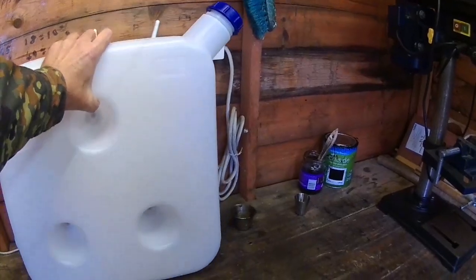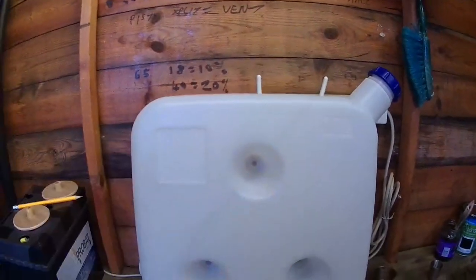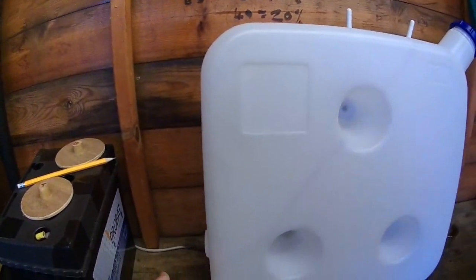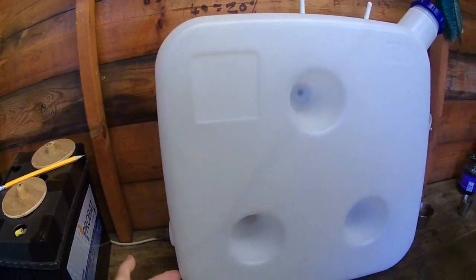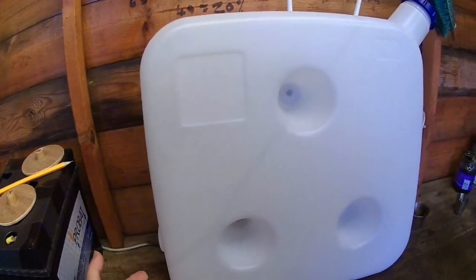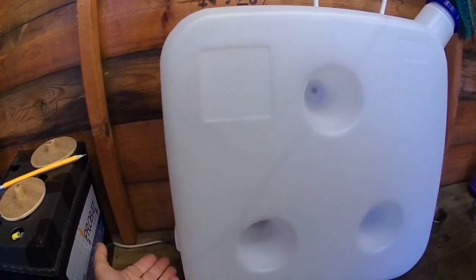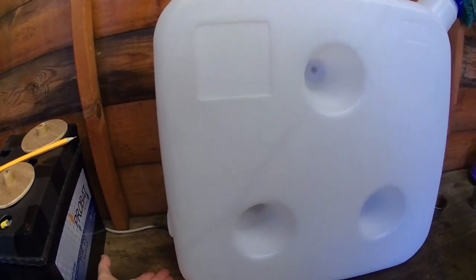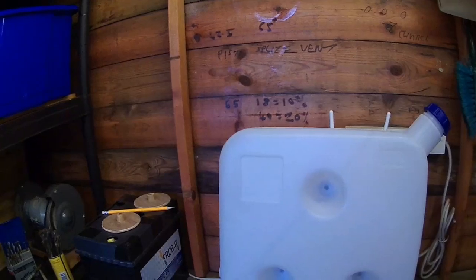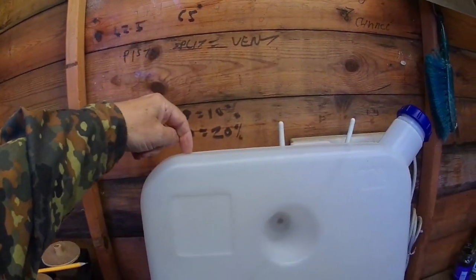The simple reason is, when this is full of paraffin or diesel, if you need to take the tank off and you've got to disconnect the line, which is at the bottom, you've got to drain the tank, and if this is inside your van, it's quite a job to do it. You've got to block the pipe up, and by the time you've blocked it off, you've got paraffin or diesel running inside your van.